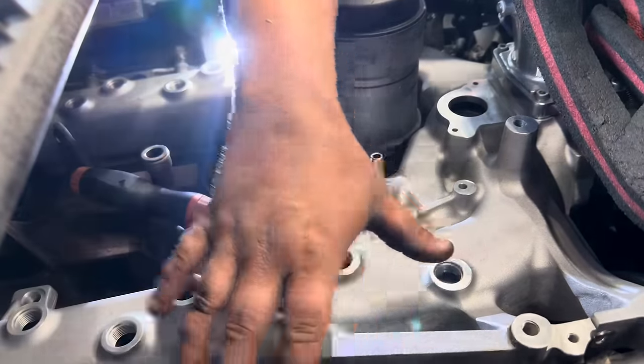What I also noticed was that once we had clearance, we did have to space out the one idler pulley up front. It was for sure hitting after we got it clearanced out. Previously, it was not, because it was hitting our oil cooler housing. So real quick, guys, please take a look at that when you're going back together, especially if you've had your heads machined or decked. So, continue on with the video.